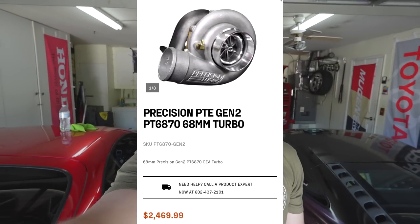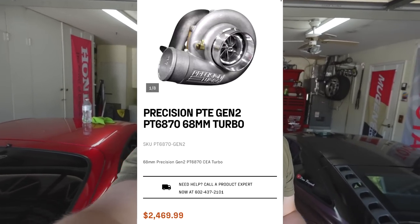My turbo is a Precision 6870 and it's rated for up to 1,100 rear wheel horsepower. I'm expecting it to max out at around 950 on the dyno I'm going to use, which would be closer to 1,050 on a typical roller dyno. The Precision 6870 will run you a good $2,600. I've had that turbo for a few years and I stand by it — none of this is sponsored, I bought it with my own money. It's not too sluggish on spool time, it's a bigger turbo, it makes good power, and it handles the anti-lag pretty nicely. So the 6870 is another $2,600.